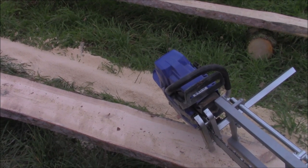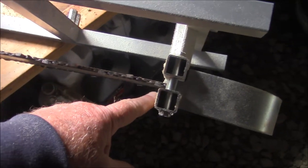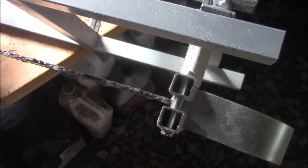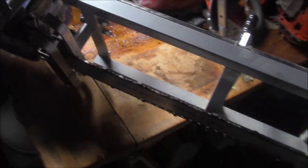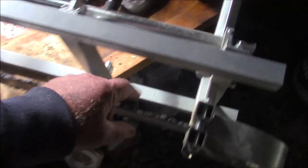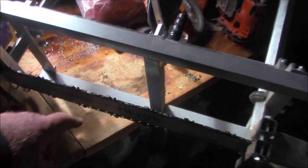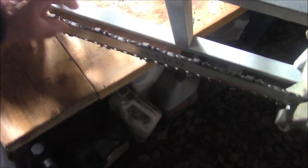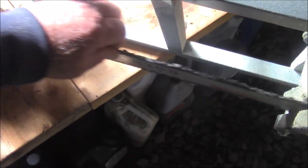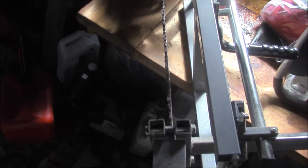So, 800-pound gorilla. That mill, those plates are not square, so it actually flexes the bar. So that'll be accelerated wear. So I've got to do something different there. And I may end up having to go back and get my Granberg, because that'll ruin my bar. I like that bar. I also dinged the T25 3-inch screws that I had set down in there to hold the first guide. So I need to take that chain off and sharpen it anyway, right?